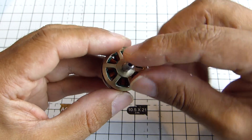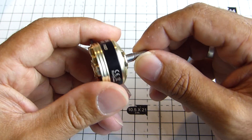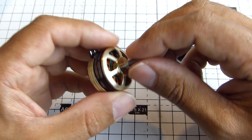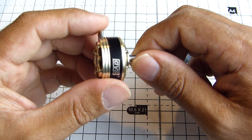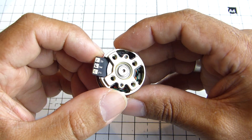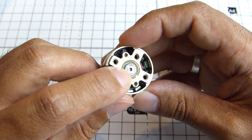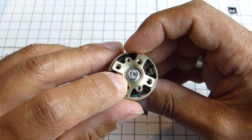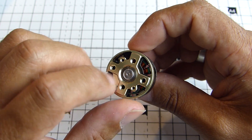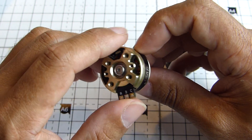A couple of things I really like about them. They've got the hollow shaft, which has a real nice strength advantage, which is great. And so far I've been impressed with that in terms of their durability. One of the nice things about having a hollow shaft, of course, is that they can do away - and they have done away - with the C-clip. So what you now have is a small bolt that screws in with a washer that just touches the inner race of that lower ball bearing, which makes them really serviceable and easy to clean out. I'm a big fan of that idea.